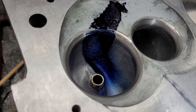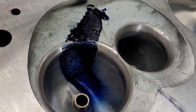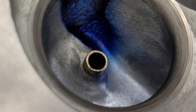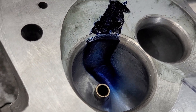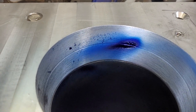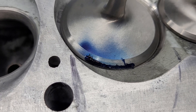As far as our liquid flow, I did work on spreading us out — we did not have that last time. Now I spray a little extra blue; I try to spray the same each time but you never know. It's certainly interesting the way it starts at the roof — goes right to the roof, does the curve just like a small block, forward and then out. It did improve because we've got blue all the way over to here now, which we didn't have before. The bore certainly looks like I sprayed a little more than usual, but we've got blue quite a bit back and a nice hit there with some splatter action.